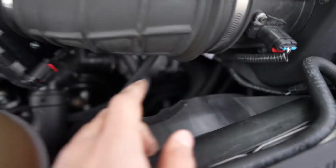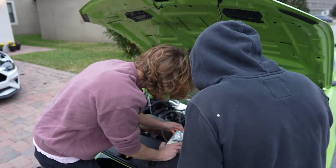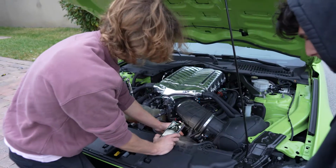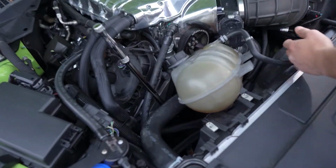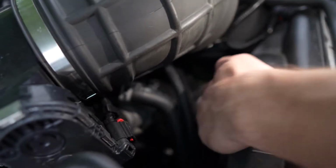So there's a slider pulley on the bottom right there, which is another idler pulley that can be adjusted. So we need to loosen it and slide it down. It's fully adjustable. So if I use common sense and I loosen that one, Fabrizio, is that gonna tension it? Because it looks like it's getting tighter when I do that. Or should it be more push? Because it goes around the alternator right there. And if I keep loosening it, it's sliding down.